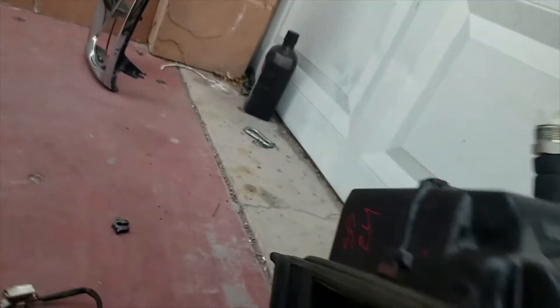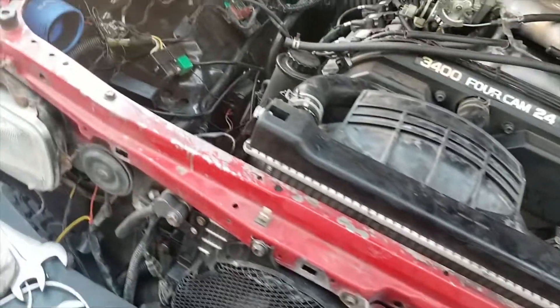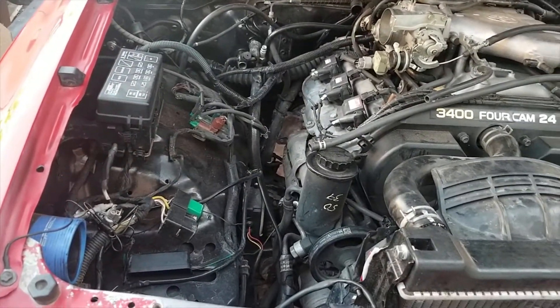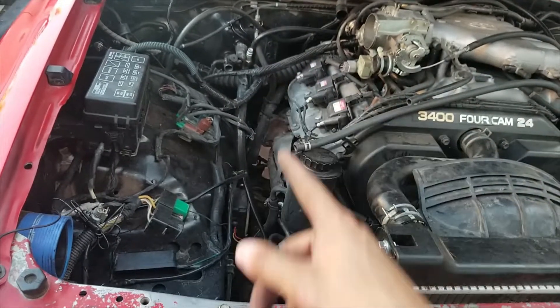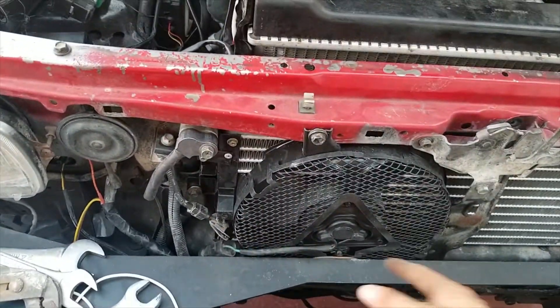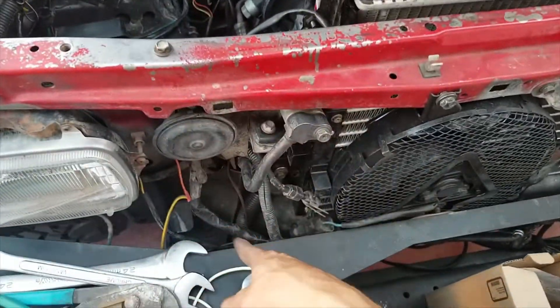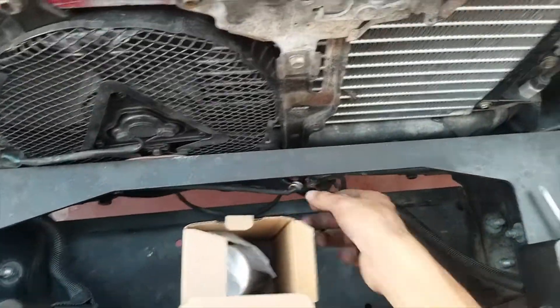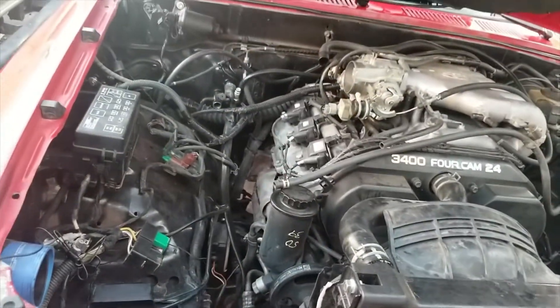The date on this part is August 1st 1994. I got the condenser for the R134A and I'll put all the part numbers on the YouTube channel. You need the suction line from a 4Runner or pickup that came stock with R134A. The high pressure line must come from a pickup — 4Runners have a different style condenser. You also need that small fitting as well.